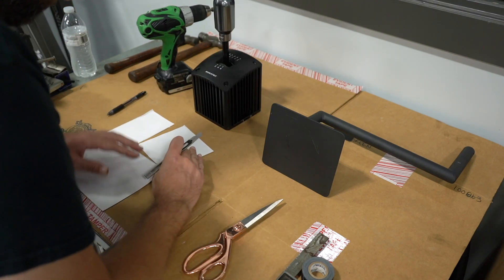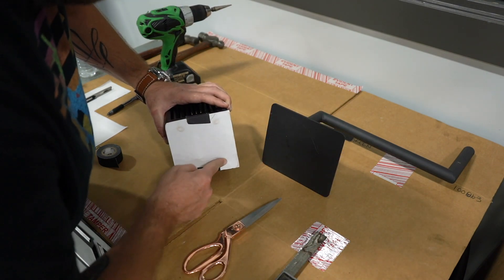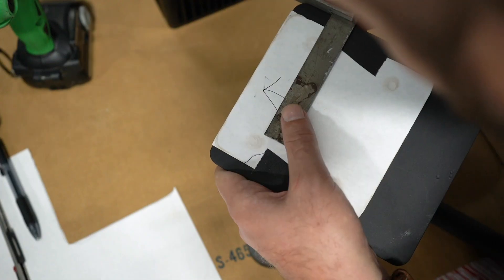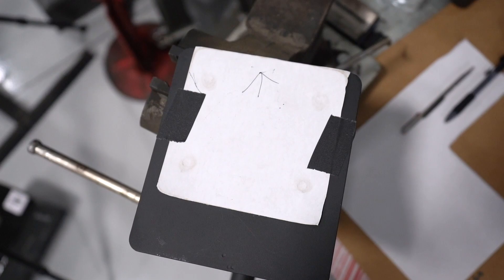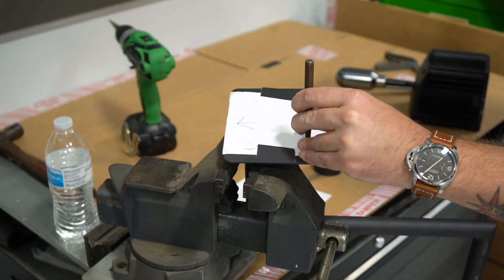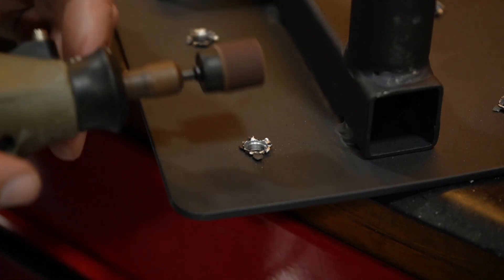I cut the paper to the same shape as the bottom of the shifter, then taped it in place, making sure it was lined up and positioned evenly. I got my finger dirty from this welding table and rubbed the bolt holes, making an impression of their location. Transfer the template to the shifter mount in the correct orientation, then measure the outside of the bolt holes and make sure it's square with the sides of the mount. Center punching the holes is the best method to ensure correctly located drill, so if you can do it, I highly suggest it. I used a small unibit, but a regular drill bit will work here. Something like 9/32nds should be fine for 6mm bolts. Be sure to deburr the backside and you're all set.